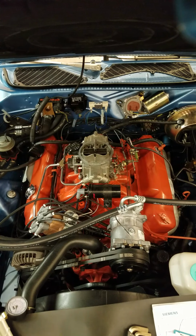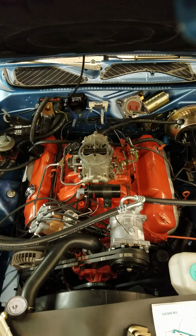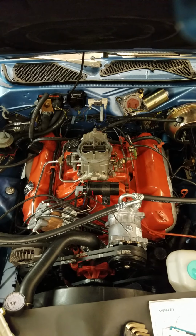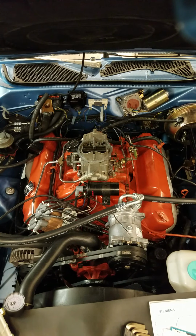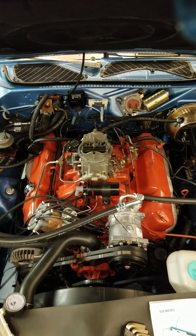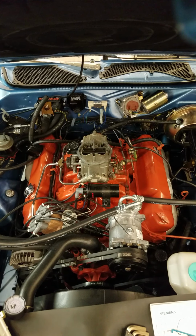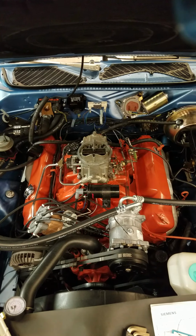See, when the engine's running at super low RPMs, that timing has to be so far advanced to get all of that fuel burnt. That's why, puttering around, we've got stinky exhaust. So much of that unburnt fuel leads to carbon buildup, eventually increasing the octane requirements, reducing valve airflow potential. All that unspent fuel goes out the tailpipes. It stinks for one, and then for two, when you've got fancy exhaust tips like I just bought, it soots them up.